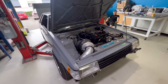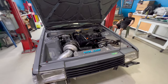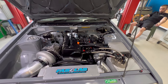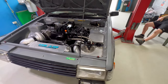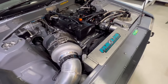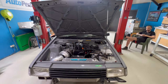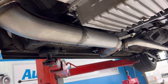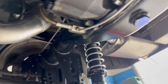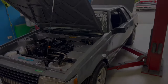Building a car like this as a drag and drive car is a totally different ball game to a drag car — you need to go from race mode to street mode with as little work as possible, and you have to worry about cooling and trans cooling. Quick recap: we've changed to a billet block, changed to a G45 1600 with a 1.28 rear housing, changed to eight methanol injectors — four 520 pound and four 720 pound Fuel Techs. We've changed to two Elixir 1380 litre per hour fuel pumps instead of one. Dan at Fab Lab has done all the radiator and pipework again — about five times now. We've also changed to a full aluminium driving exhaust: still steel down to the AES valve, then two and a half inch aluminium to the back of the car. That's it for this one, over and out.